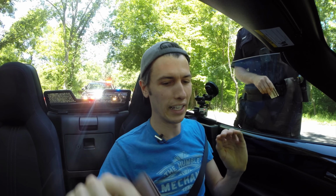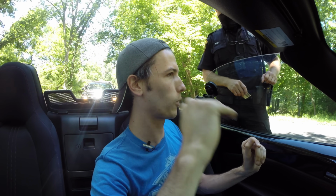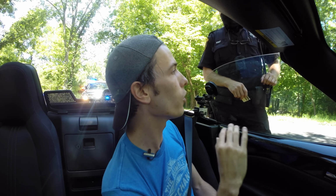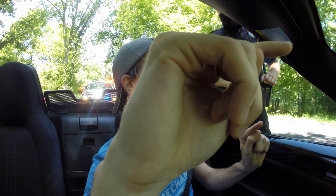Okay, so I just put a supercharger on this Miata. I run a YouTube channel called Engineering Explained, and I teach about how cars work. I've been having a lot of problems with this car. The throttle tuning has been all off, where it wouldn't ever get into boost. The reason was the accelerator pedal says it's at 100%. The communication from the car to the throttle says open up all the way, and the throttle would just sit at 25%. And so it wouldn't work. Finally I've been working with this shop to figure it out and get the tune on, and somehow now it works. Is it all electronic? It is. That's kind of a challenge with new cars, the throttle pedal isn't mechanical anymore, it's electronic. So the communication was somehow broken, and now it's fixed, but yeah, I accelerated.